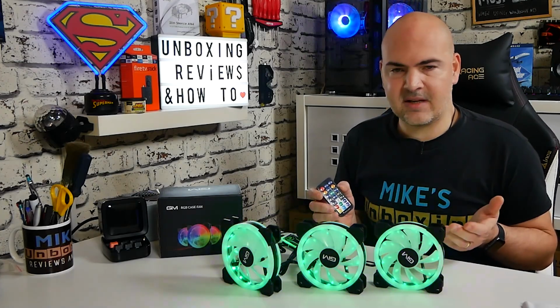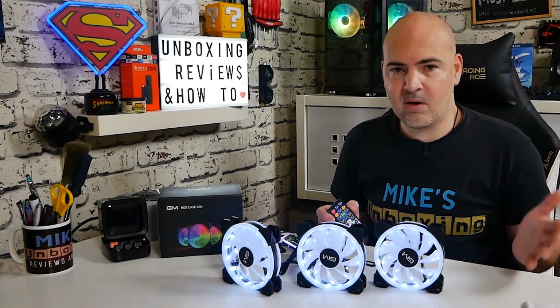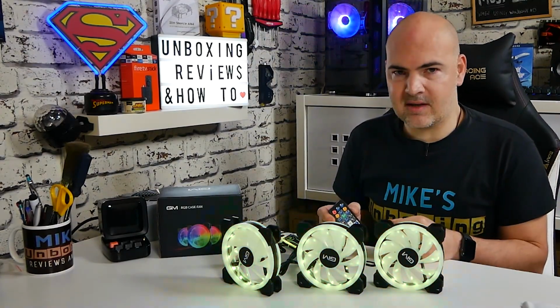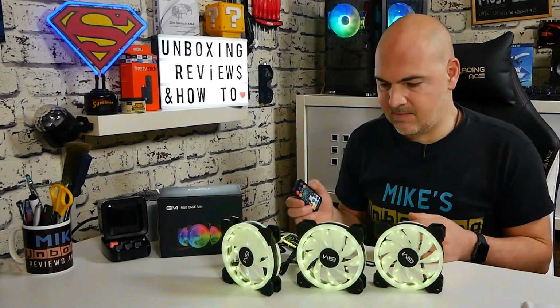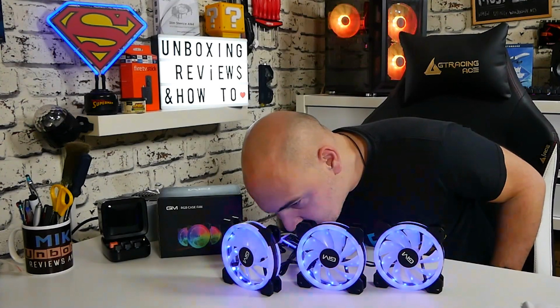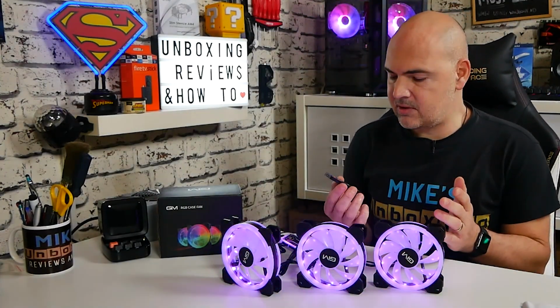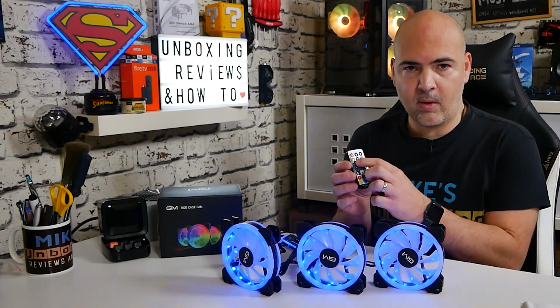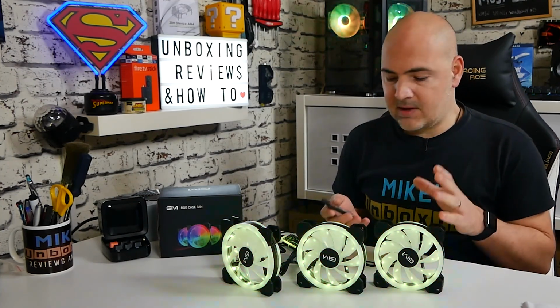this is more of a standard color section, so if you're with the normal RGB in your system, maybe you've got the older 12 volt RGB, this may work quite nicely because it doesn't have the addressable effects but still does that kind of color flow thing, which is pretty good. The actual sound is picked up by the controller, so the closer you get to the controller, the more reactive it's going to be. You can change the reaction actually using the buttons on the remote control, so it's less sensitive if necessary.